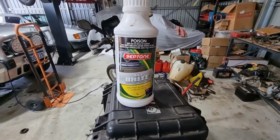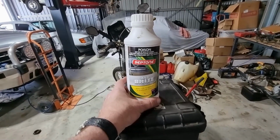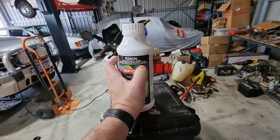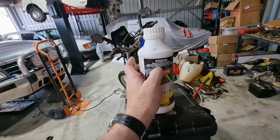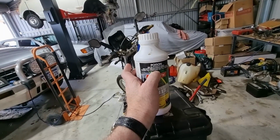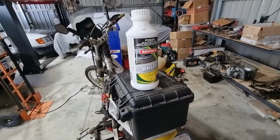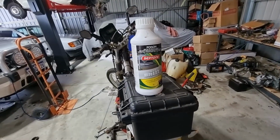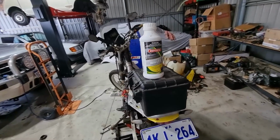Okay, the product I used is called Septone Alibrite aluminium cleaner. The warning I would state for cast aluminium is that it is an etching agent. It's got sulfuric acid in it. It's got hydrofluoric acid as well. Nasty. I thought that stuff was banned. If I'm not mistaken, that stuff can eat through your skin and give your bones a pretty hard time. Anywho, so this is the etching type. It's not good at all for painted surfaces. You'd never use it on that. Make sure you rinse it off really well, otherwise you'll continue to corrode after you've put it on.